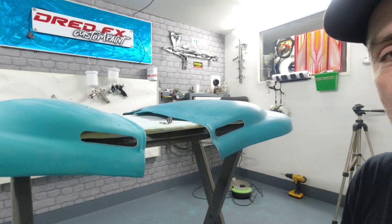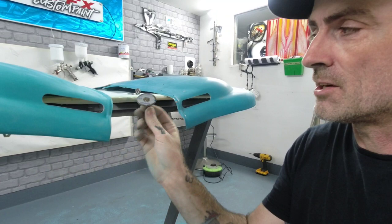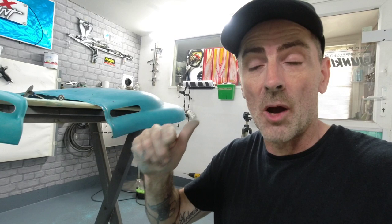Vents out, give you a little pan round and show what we've done. So I started off with the little Dremel disc, which is this one here. These are really good. I've just done some straight cuts down both sides on both of these, and then went in with a drill bit, like an 8mm drill bit, nice and slow. Drop the speed down to one on the DeWalt and just go in really slow. There's nothing worse than drilling into steel going too fast. You have to go nice and slow, as the drill bit just warms up too quick.